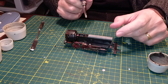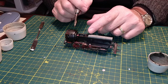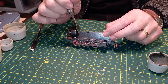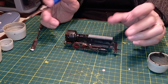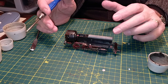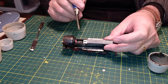In a previous video - dedicated video number one - I was mentioning that the BR64 doesn't have that sort of plastic collar between the motor and the chassis of the locomotive, which catches in these two pegs that catch in these two openings. Why does it not have it? Because the BR64 has a shorter bodywork compared to the BR75, and anyway we'll go through this at the end comparing both chassis. So there is no need to have that plastic extension between the motor and the chassis, where the worm screw meets the gears.